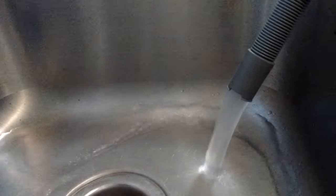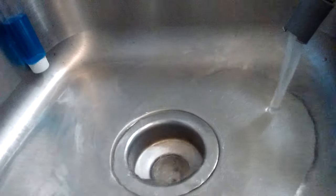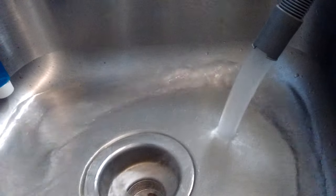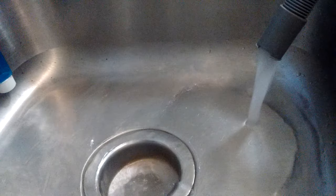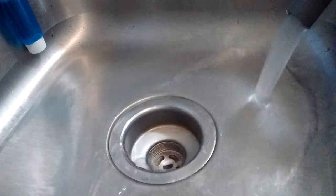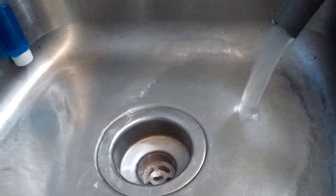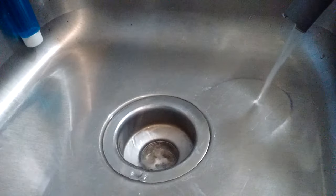As you can see, the pump is intermittent. This was specially designed to prevent overflow, in case your sink drain isn't very efficient. It drains water slowly, pauses, then drains a little more, just to give the drain time to clear. If the machine drained too fast, there would be a chance of filling up the sink and overflowing before the drain had a chance to handle all the water.